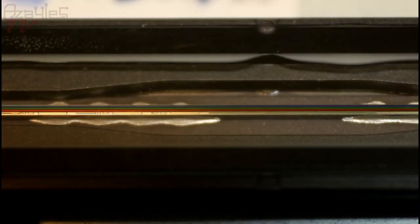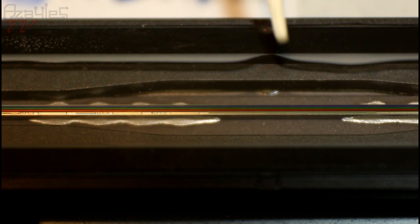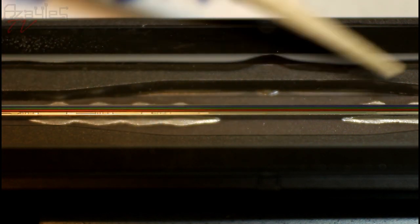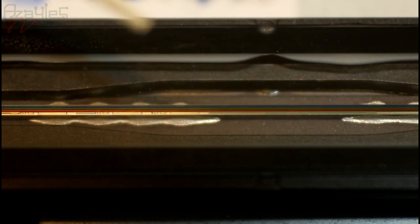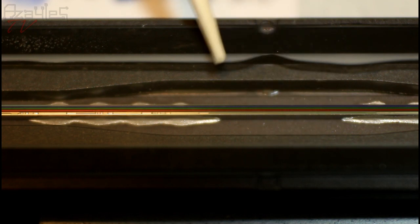Okay, this is crazy. I did not expect to see this at all. What have I actually got here? This gold part you can see just under there. And this is how small this is. I mean, this is a cocktail stick slash toothpick, whatever you want to call it. Now the gold section, the little yellow stripe, is the control chip for the sensor array, and the sensor array runs the entire width of this thing. It's got thousands upon thousands of little tiny pixels, and there's actually three other rows after the gold control chip, and they are three separate sensors for red, green and blue.